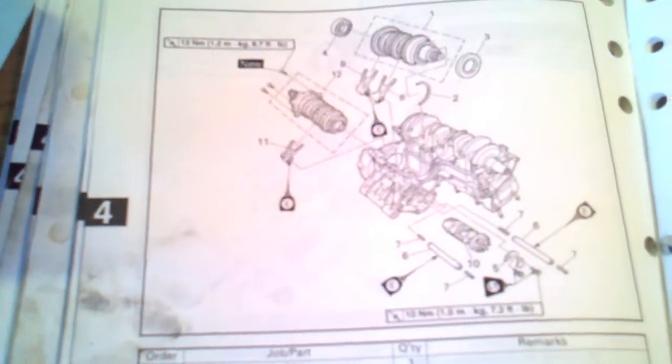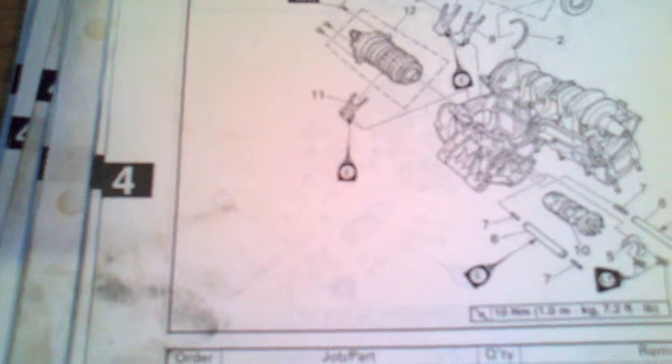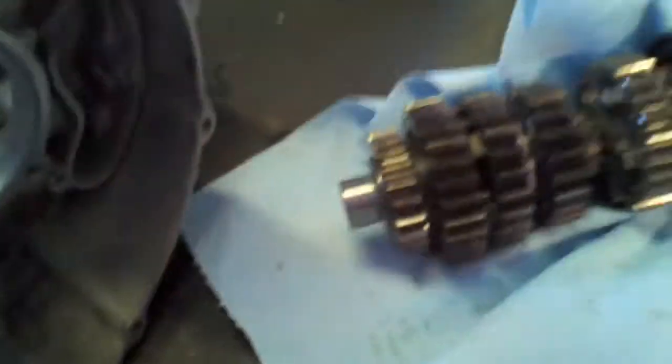It's time to reinstall the transmission. I've been looking over the diagram to re-familiarize myself with all the parts, where they go, which bolts need Loctite, which ones need to be brand new — I've already ordered new bolts for the main axle. Following the factory procedure, first up is the main axle assembly, which fits into this opening and comes back to slot into the press-fit bearing.